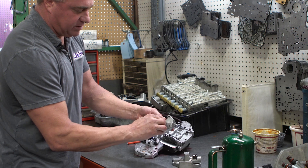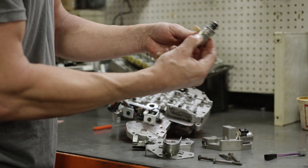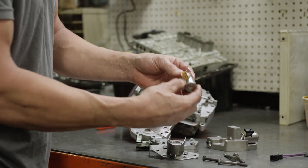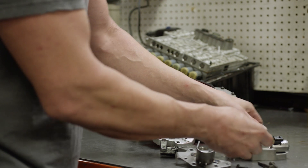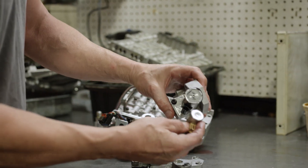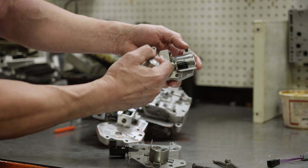There are two pieces to this block. The solenoid we're upgrading is this little guy — this very cheesy one. It just doesn't work very well; it strokes really slow. So this is a GM solenoid that is actually a miniature pressure regulator with a balancing circuit.